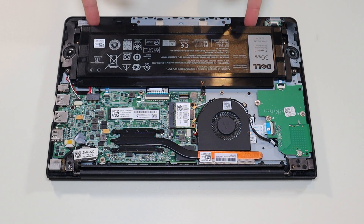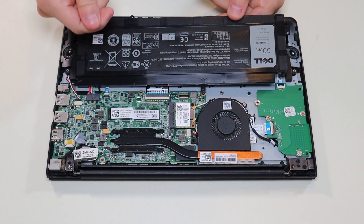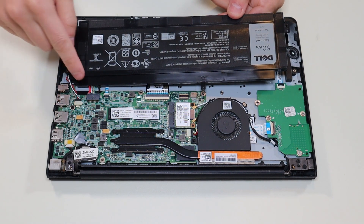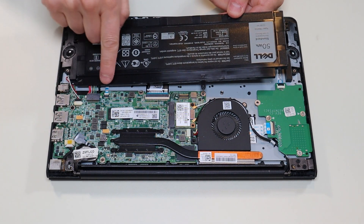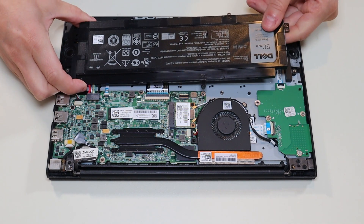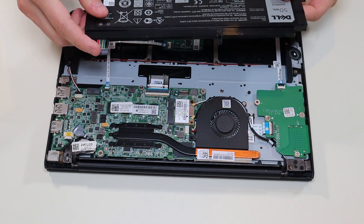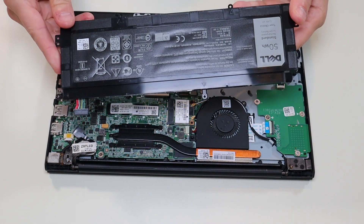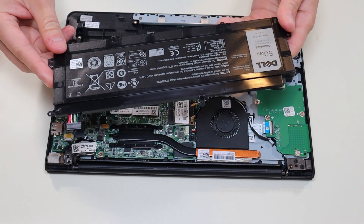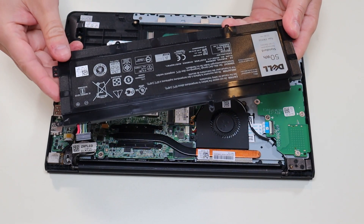After undoing those screws, the battery can come up just a little bit. Even though it's best to never pull on the wires when unplugging something — you always want to manipulate the plug and not the wires — this cable is so short and there's no real grip on that plug. So to get the battery out of that port, you would have to just slowly, gently try to wiggle it out, which is not ideal, but in this computer that's what you have to do. If you want the battery spec information for a replacement, I will have it below in the description, along with a replacement battery in the parts link for this model computer.